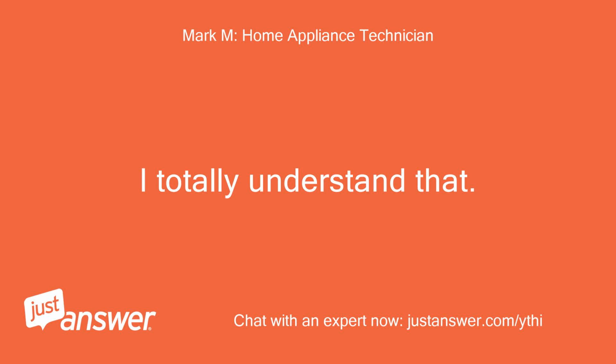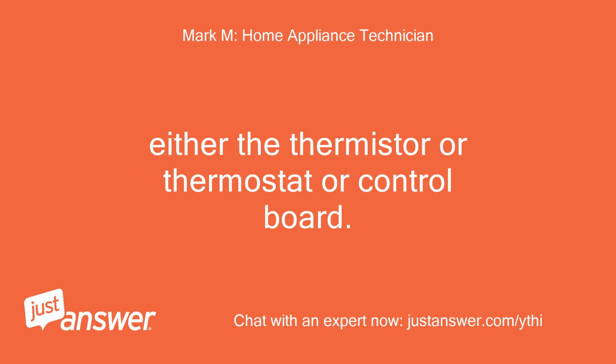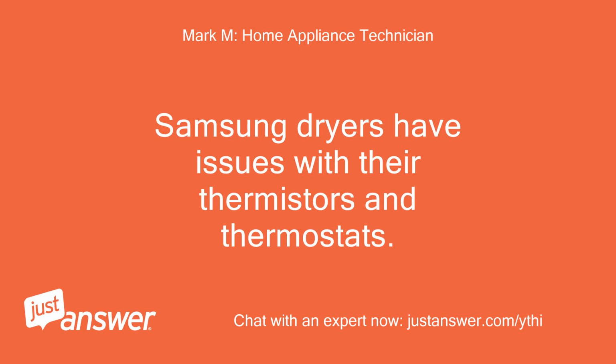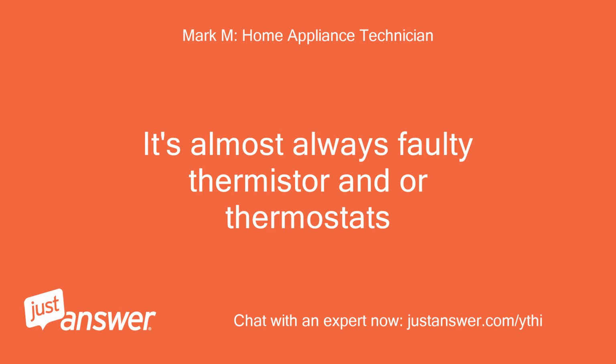I totally understand that. You do have a faulty part though, either the thermistor or thermostat or control board. Further testing of those parts will narrow that down. Samsung dryers have issues with their thermistors and thermostats. I have been on calls for Samsung dryers before with this exact issue. It's almost always a faulty thermistor and or thermostats.